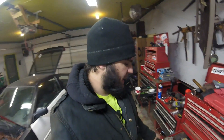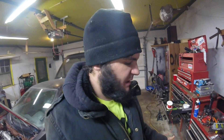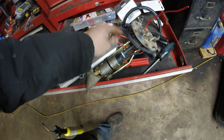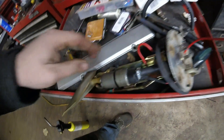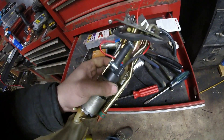I got the fuel pump out and I'm swapping it with a factory Integra fuel pump — that's the only thing I got right now. I'm waiting on a Walbro 450 from a guy that he's going to be selling me, but for now I'm just going to put a stock Integra pump in just to see if that CRX pump was bad, because I know this one is good. I got it into the hanger here, just redid the wiring a little bit — ran a new ground wire and a new power wire out. I also got some new hose on it, just a 3/8 fuel injection hose that I clamped on there, zip tied it, and reused the sock from the other pump.